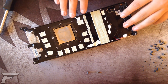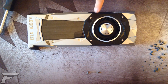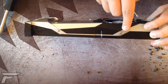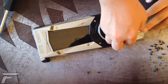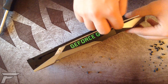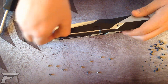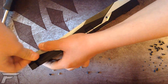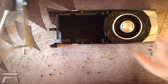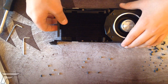If you want to make a hybrid card, the procedure is a bit longer. Just flip over the card and use the two and a half millimeter Allen key to remove the four screws around the fan and the three screws on the sides. You won't have to remove the four screws on the center of the card because they're just holding the transparent plastic. At this point the stock cooler will come out.